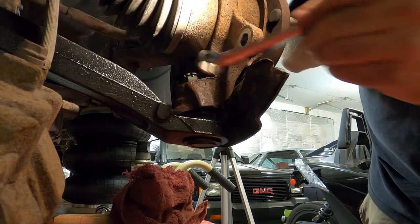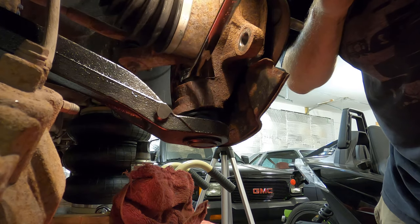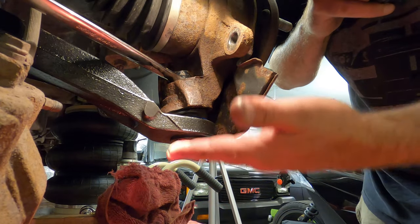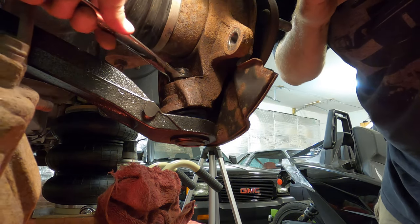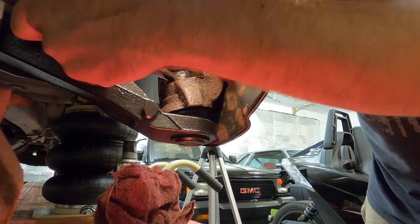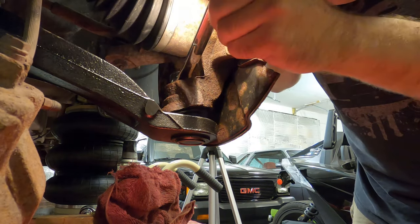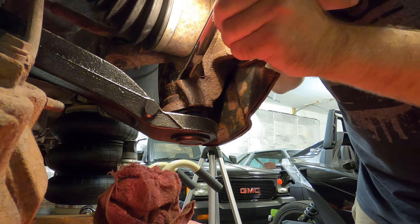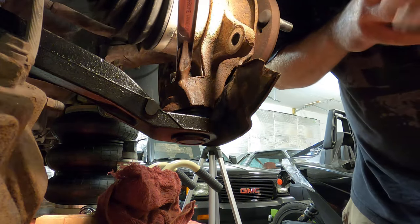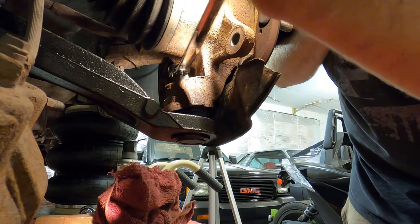Unfortunately there's not room for a socket in there, so you have to work with a 19 millimeter wrench — you can only turn it about a quarter turn at a time, but that's okay. I'm going to suck the ball joint up into the spindle, and then I can jack underneath the ball joint to raise it so the control arm is more level and we can line up that back bushing bolt. The suspension will be loaded as well so we can tighten the bolts properly. You don't want to tighten those bolts with the suspension fully extended. The torque spec is quite high — you can't get a torque wrench in there so I'll just do it as tight as I can with the wrench and then put the cotter pin in.